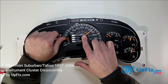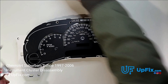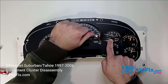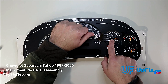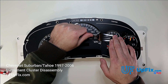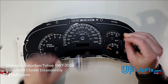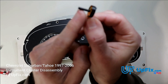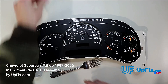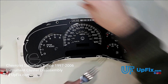We're going to do the same thing here — hold the force and pop out, and you'll hear it snap. If the needle doesn't want to come off, then just take your time. If it's old, you'll see the inside of the gauge needle actually flex. If you pry on it quick and fast, you'll probably break it off and you don't want to do that. Keep the pressure on your wrist, and there you go. What I mean by the stem — this stem right here will break off if you pry it off too quickly. So we'll just do the rest like so, and you can hear it snap off. Some of them come off a lot easier than others.